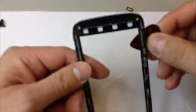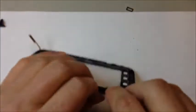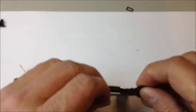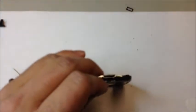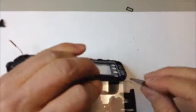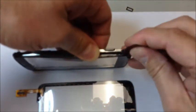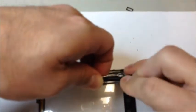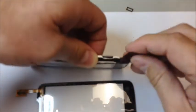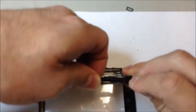Be liberal with heat application if you need to, but don't get the phone so hot that you melt something. When I first took it apart I wasn't sure how those squares were connected — I thought there might be adhesive. It turned out they weren't glued on, but they sit right up against it, so it's easy to slice through them if you're not careful, even with a pick. Take your time and make sure you're going between the glass and those white squares attached to the bezel.